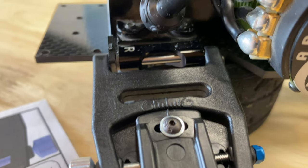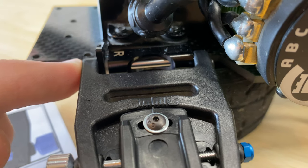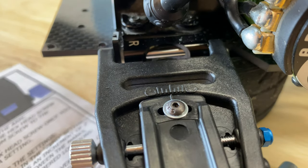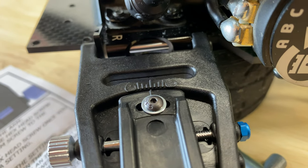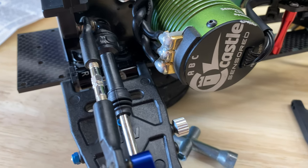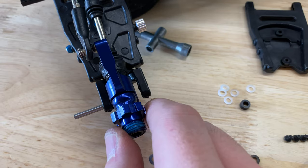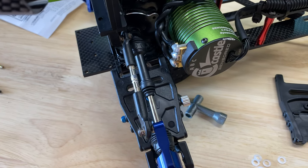The perfect fit for my situation was to put the arm on with just one little white spacer, push it all the way on, and then barely squeeze on the clip. That made it move up and down smoothly but stay in whatever position you put it — just the right amount of movement. It results in no forward and backward play, which is great for high speed stability. With the clips on the back side the arm is pushed furthest back, and I'm putting my spacers on the right side of the carrier to push the wheel just slightly back.